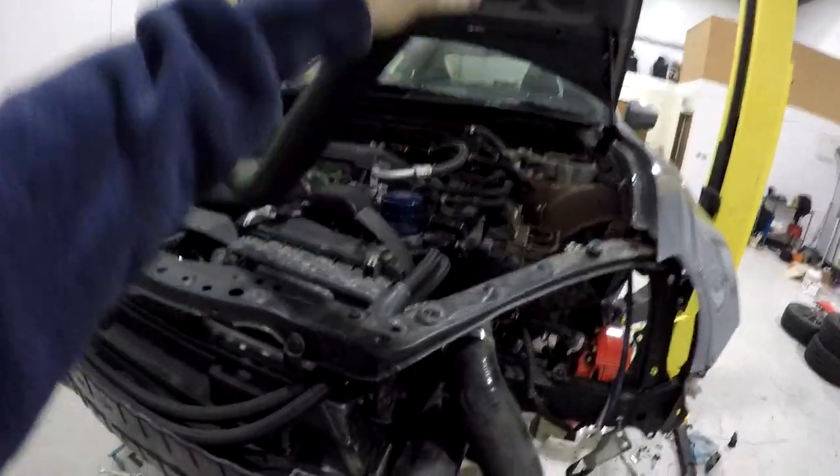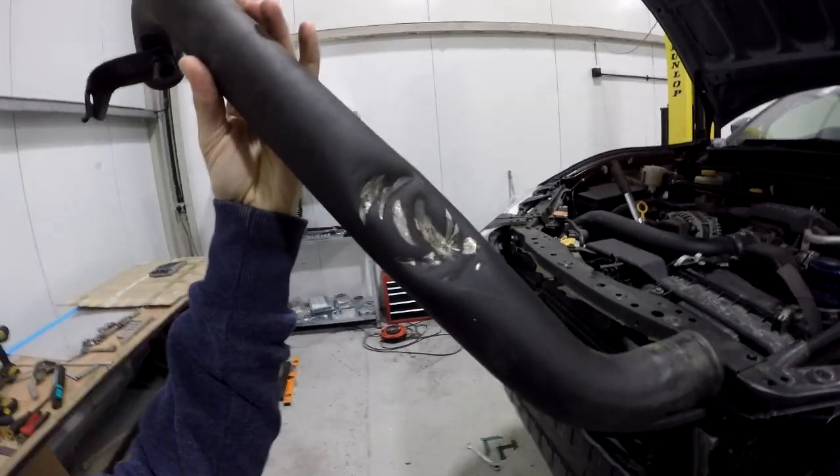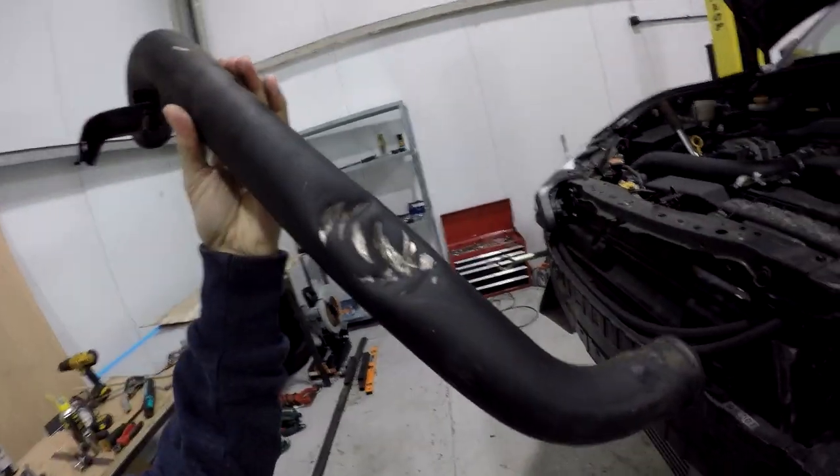The water pump - this inter-cooler pipe basically sits like that, further back in here, and the problem is the back of it has had a few run-ins with the water pump pulley which has kind of mashed the heads on the bolts, which made it a nightmare to get off. I had to weld some new bolts to the old bolts because the heads were so damaged you couldn't turn them or get mole grips on them. So I've welded new bolts to those old bolts so I could turn them - that's got them loose now. I've got the belt and everything off, so next job is just to drain all the coolant out and pull the water pump off.